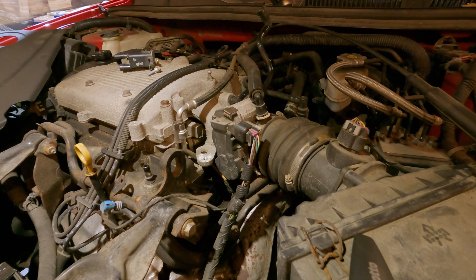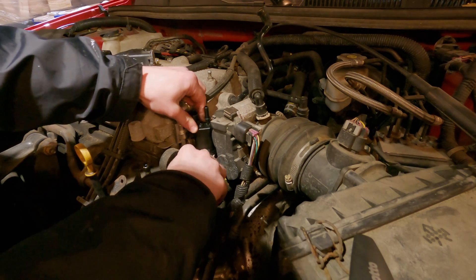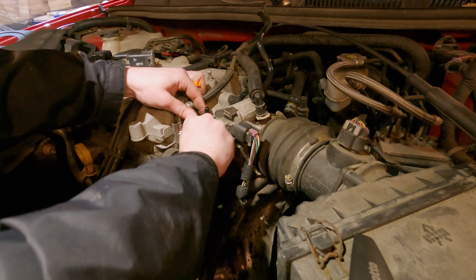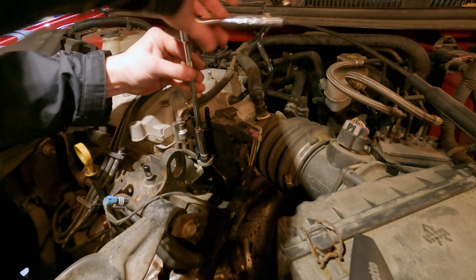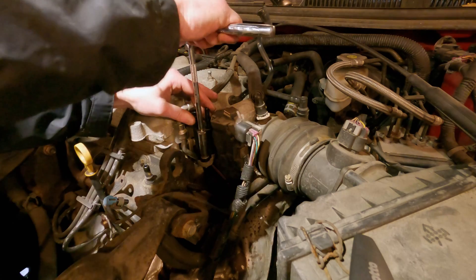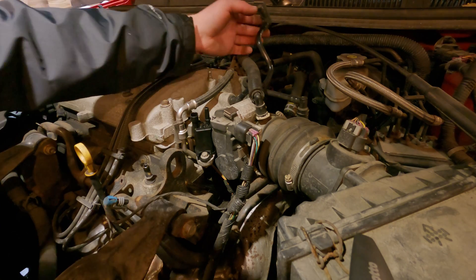Part number is in the description. And look at that — it even looks right. We will screw our 10 millimeter back in. We'll insert the torque specification if I can find it, otherwise good and tight. Do not over-tighten it — it looks like a little aluminum bolt, probably about 8 newton meters.